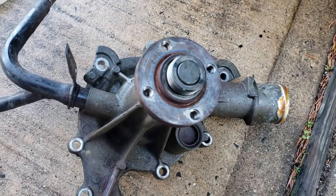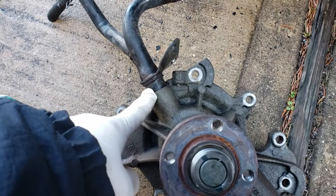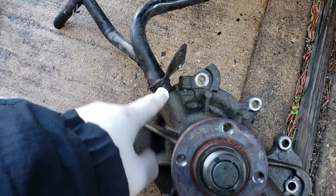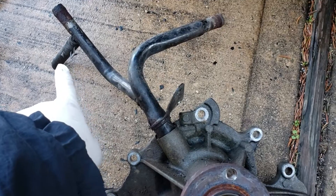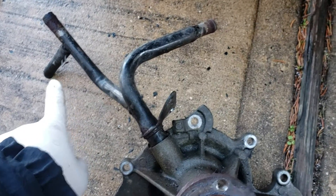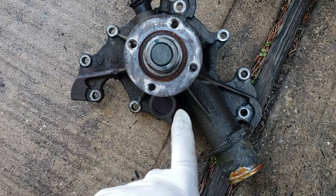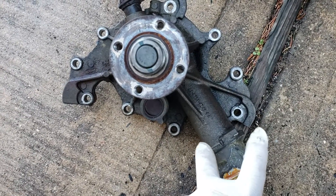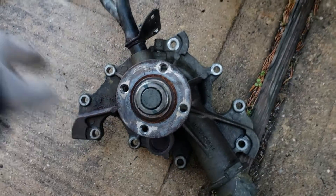Then you're going to see the water pump. The water pump is going to stick out there — it's got this heater inlet pipe, it's pretty much in there, I'll explain that in a little bit. It's got two heater hoses here and a little tiny hose that goes to the right side of the engine. These are the bolts that hold the water pump in, and you've got the lower radiator hose — just disconnect that and move it out of the way.